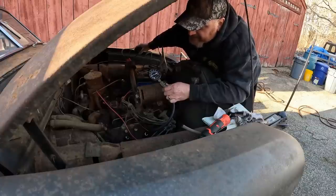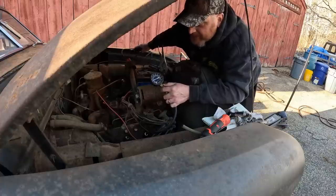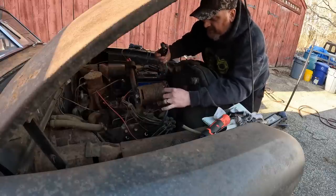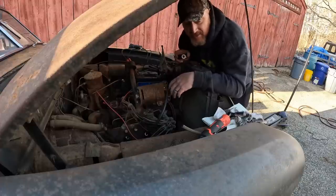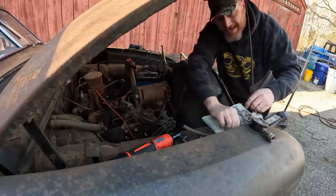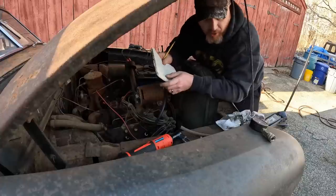I saw 90 on it. It's bleeding down, but it... Oh, it's loose here. It's loose at the... Yeah. I just saw 110. Okay, so we're gonna go 110. This seal isn't great, but I mean, if it's got a stuck valve, we're most likely gonna see 0, right? It's gonna chug it up, push it back through the intake side. So we're gonna throw 110 on our sheet. This is a very high-tech recording device. 110 in number one, perfect.